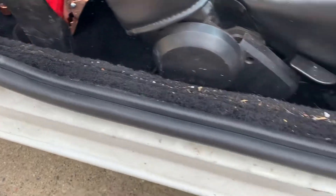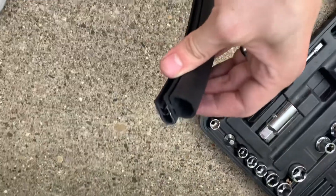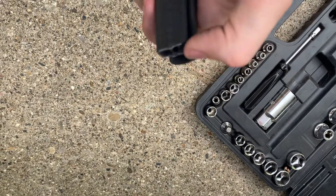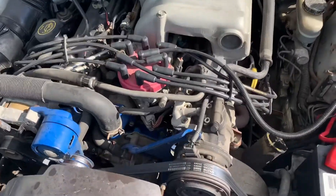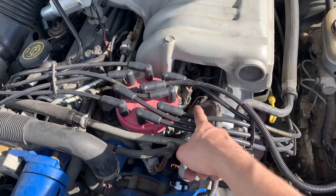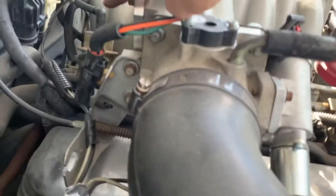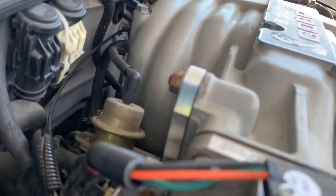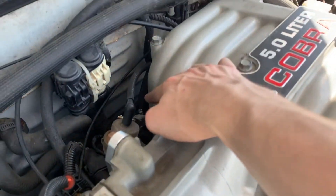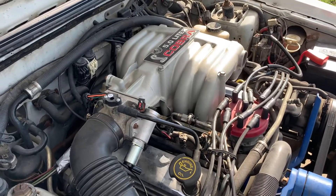Now I'm going to move under the hood and talk about future things I'm going to do maintenance-wise to get it running right, and some modifications. When you're cutting it, just keep in mind that there are sections of metal, so you want to try to cut between them. What I'm going to be doing soon: the ECT or engine coolant temperature sensor, the ACT air charge sensor. I'm going to be adding a fuel pressure gauge because it's running really rich, and I'm also going to be changing the stock fuel pressure regulator — this thing has bigger injectors and the stock regulator is still on there, which it shouldn't be. I'm also going to be taking off the intake manifold to do a lot of things, including the PCV valve. We'll see where it goes from there.